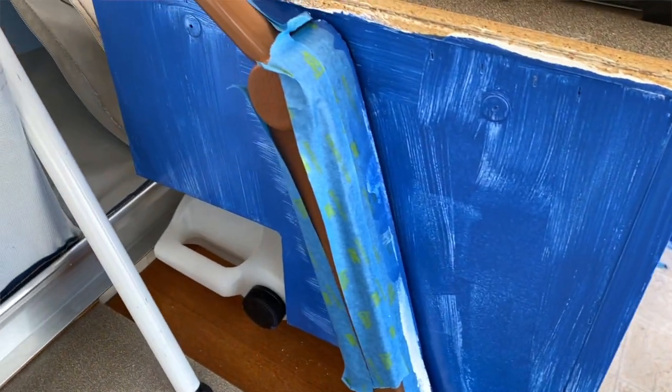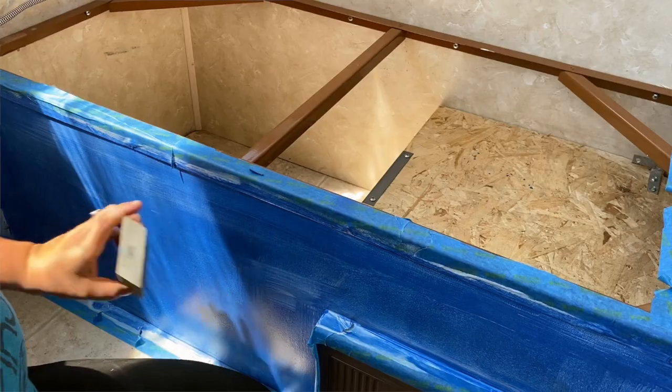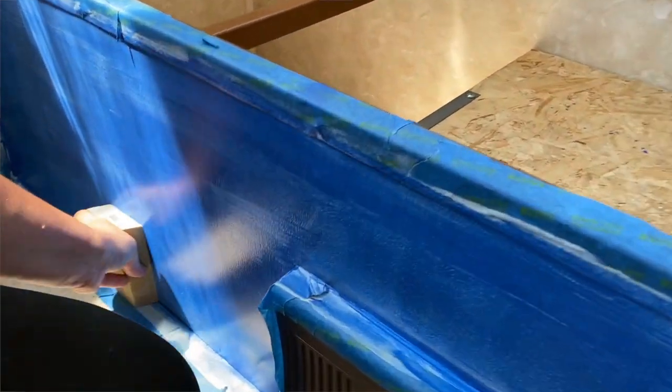Getting back to the camper after overnight drying — one more coat is definitely not going to be enough; it looks more like a primer than a good overcoat, so I'm imagining it'll take two more coats with plenty of drying time between them. Morgan's sanding right now to even everything out and remove any clumps from the first coat. Two important tips: wear gloves — we've already gone through many pairs — and wear clothes you're comfortable ruining, because you will stain them.